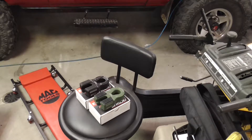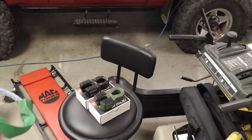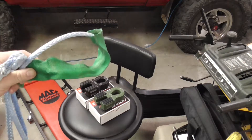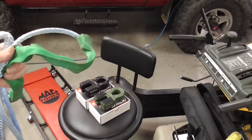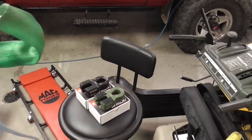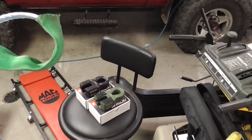And if you ever winch, you know you can't control how it spools back up. When you're winching under load, you can't control it. So I found out — that's a 9,000 pound winch — when I looked at the specs, the steel line was rated about 11,000 pounds. So it's just barely rated, and this synthetic winch line I got is rated for 20,000 pounds.